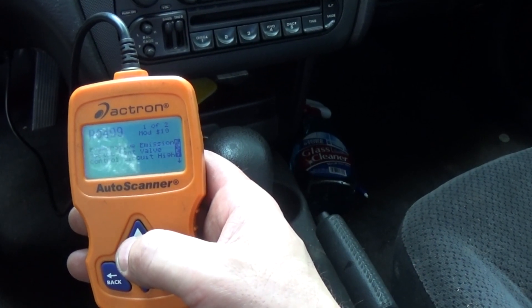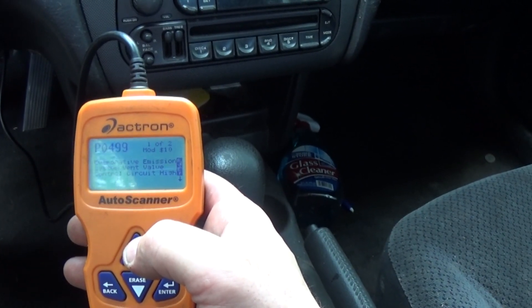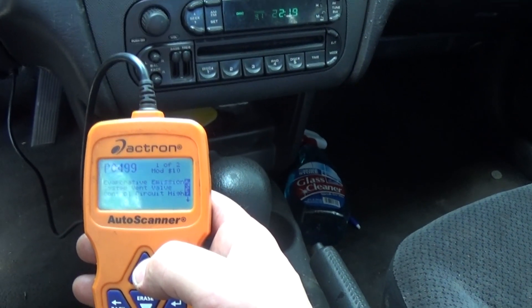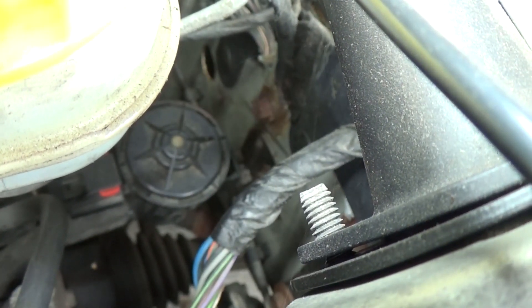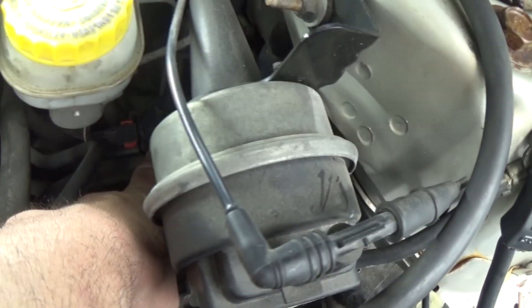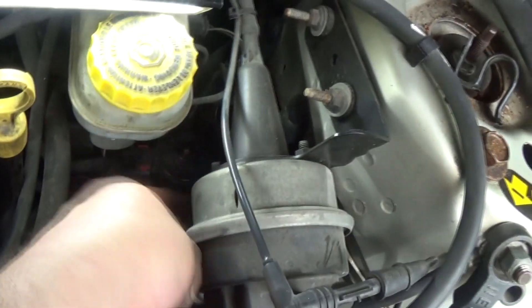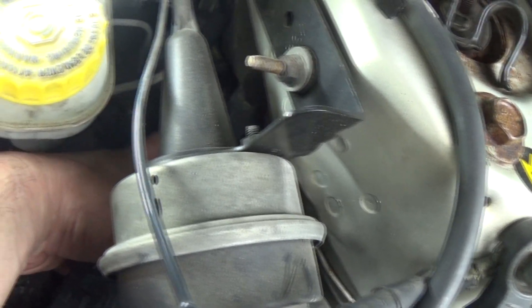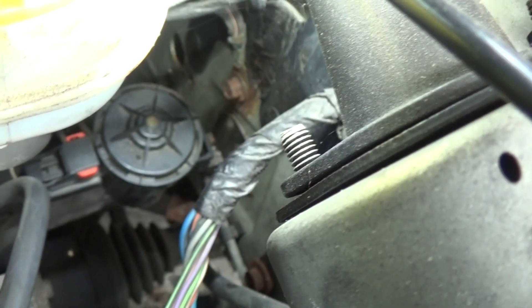I talked to the owner — instead of digging through the harness right now, I'm going to cut the black and red wire and connect it to ground to get the car to the garage for further investigation. But while pulling on the wire it looks like the ground is actually right there — there's another ground point and it's also corroded. I'm going to repair that and see if that's the real problem — most likely it's not an open wire but just a bad corroded ground.